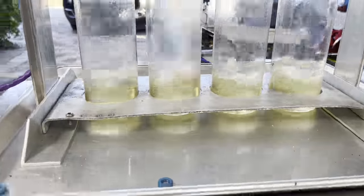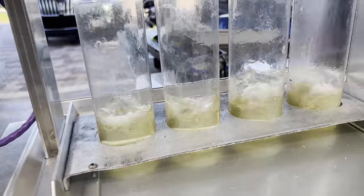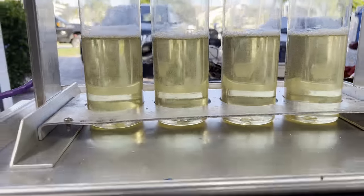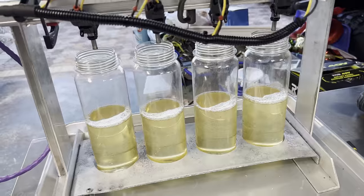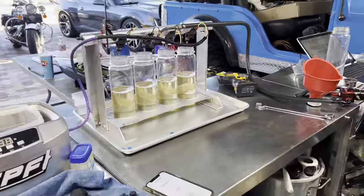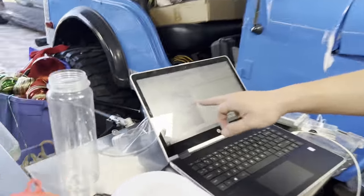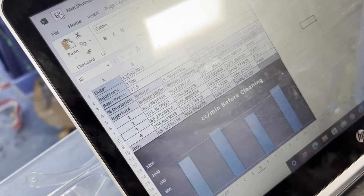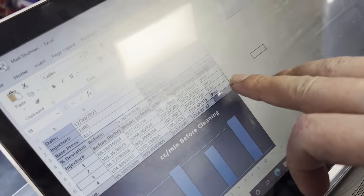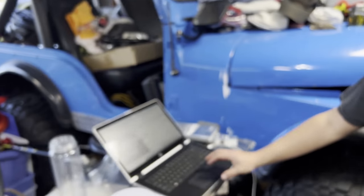After cleaning, it's looking a lot better. After the final test we're at 1.41% flow deviation — down from 9.76% — at almost 1,100 cc's per minute, which is right where we want them. That's really good. The backflush was definitely the key. It's crazy what a simple cleaning can do — now we're going to test cylinders 5 and 6, which I was most worried about.